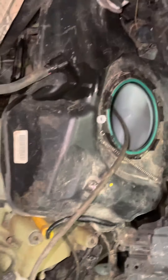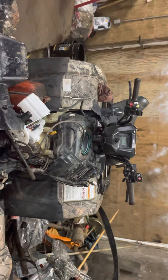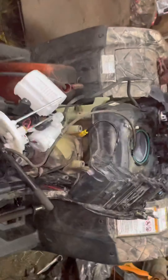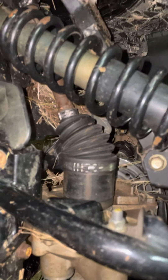I have made this so much harder for myself. Two main things I'll always make sure now: I'll always have the vent routed to the airbox — I'm not gonna mix and match. I'm actually gonna route it right inside the plenum so it only sucks in filtered air. And always grease your axle boots, or take your axles out and grease those splines. You'll never hate yourself.